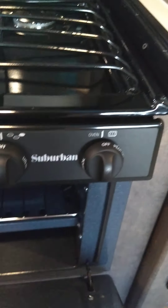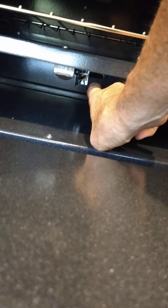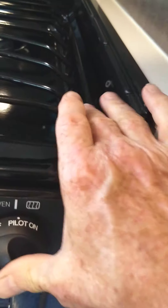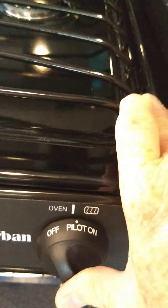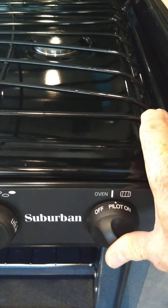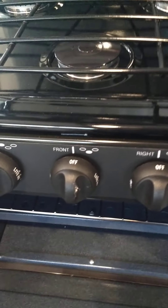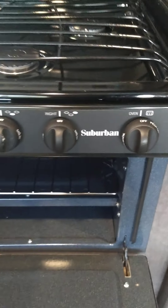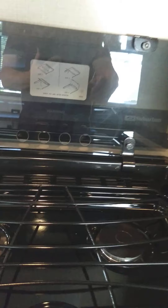For the oven it's a little different — you're going to need a grill lighter with a long neck. There's a pilot light way back in the back there. You go to pilot, depress and hold it, then go down here with your lighter and light it. Once the flame lights, you're still going to hold this in for another 10 or 15 seconds after it lights. Then you just go to operating temperature, whichever temperature you want. It'll cycle on and off like a regular oven. But when you shut off the valve, the oven flame goes out and so does the pilot light, so you have to relight the pilot light each time you use it. Always have this closed when you're traveling or it will break.